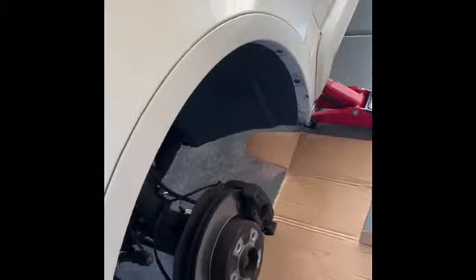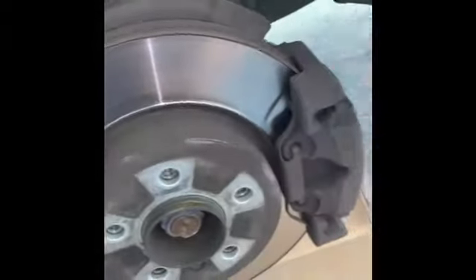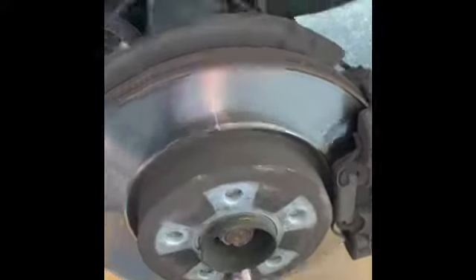If you're watching this video, I'm assuming you already know how to jack up a car and take a wheel off. This job looks pretty straightforward. You're gonna take this Allen out. I'm gonna stick one in there — if I can't get it to come out because the rotor will spin, I'll stick a screwdriver in one of these slots here up against the caliper to hold it back so I can break that Allen loose.